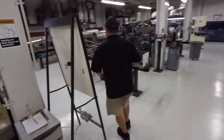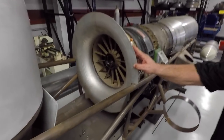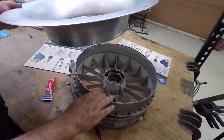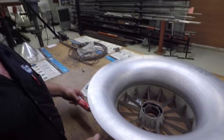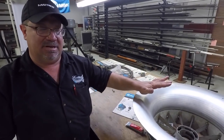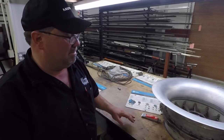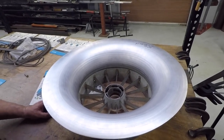We also have a bell mouth for our jet that we'll need to cut up a little and make work over the back of the El Camino. This is the actual factory J85 bell mouth we're going to use - it just inserts right down and fits perfectly. We're going to take red RTV and seal it in there, square it up, and cut it as needed. Normally you'd run a cone-shaped screen because it has more surface area, but in our case we're going to run it flat and see how it does - if it doesn't breathe enough, we'll go back to the cone.